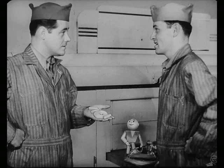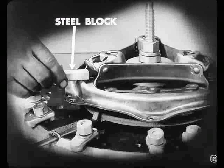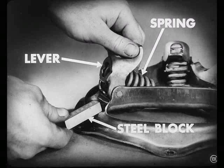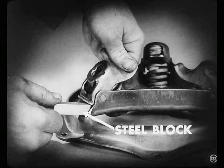How do you take this clutch apart? Well, you use the same fixture but with these adapters. After the levers are compressed, take out the adjusting screws and return springs. Then put these steel blocks from the adapter kit under the outer ends of the levers. Those blocks keep the springs from flying out when you relieve the pressure on the levers. To remove a pressure spring, press the lever down by hand, pull out the steel block, then let the lever up slowly. When you reassemble, install the springs by hand and reinsert the blocks before putting the clutch into the adjusting fixture.